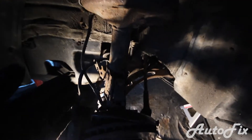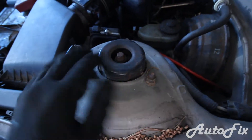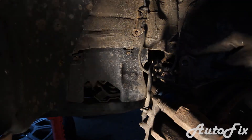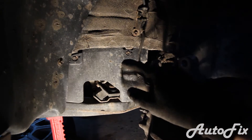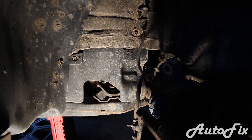If you do wish to take the whole strut out, all you have to do is undo the three bolts at the top and it should just come out. Now that the strut is out, you'll also want to remove this plastic shield right here so you can gain more access behind it, basically where the axle is.